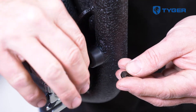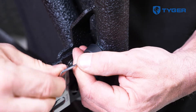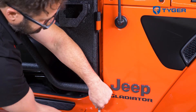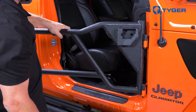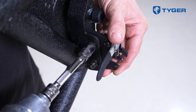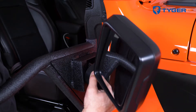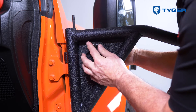Now let's go back to the door bumpers we installed earlier. Use the provided washers as buffers to adjust the spacing between the door and the vehicle to obtain the optimal latch against the striker. Once you're happy with the fit, tighten the lock nut and hinge until there's a slight resistance to the door operation — do not fully tighten the lock nut at this time. Next, adjust the horizontal alignment for the latch against the striker by using the two included hole spacers to pad up as needed, and then tighten all the hardware. Now install the mirror mount and mounting plate by reusing the three bolts from earlier to complete the front door installation.